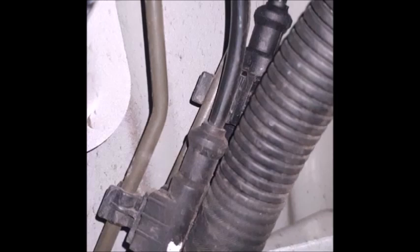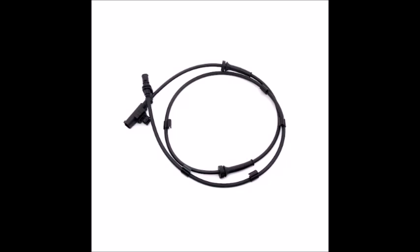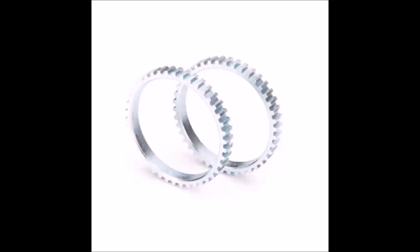Tested it again and it does appear to be working. I'm putting some quick screenshots here of the underbody on the near side for actually changing the wheel sensor, so you can unplug it, reroute the cable, and put a new sensor in if needed. Should this fault come back again, I'll be looking at getting a new ABS sensor and possibly a new reluctor ring.